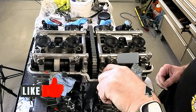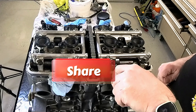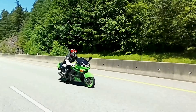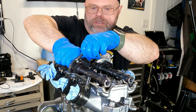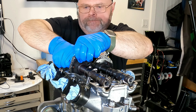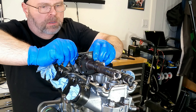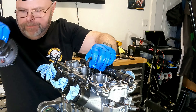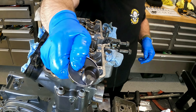All this is discussed in detail in that other video, so be sure to watch that one after this one is finished. With accurate measurements recorded for each valve, it's now time to find out what shims are actually currently under those buckets. To do this, the camshafts have to be removed along with the careful removal of the valve buckets and those tiny shims which are underneath them.